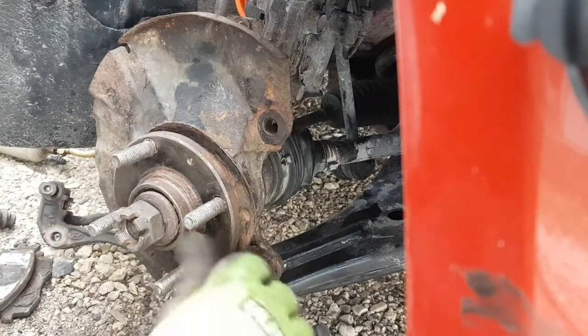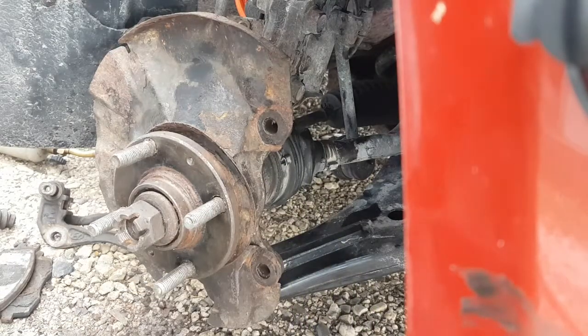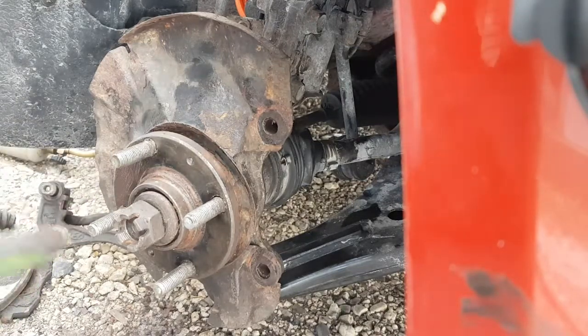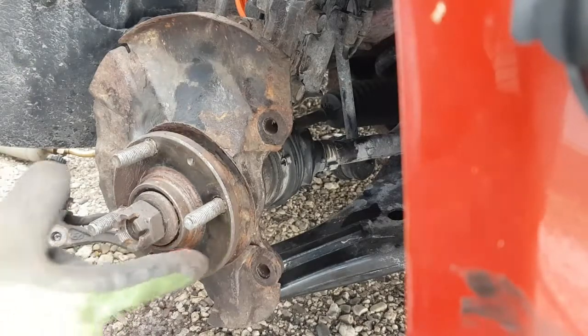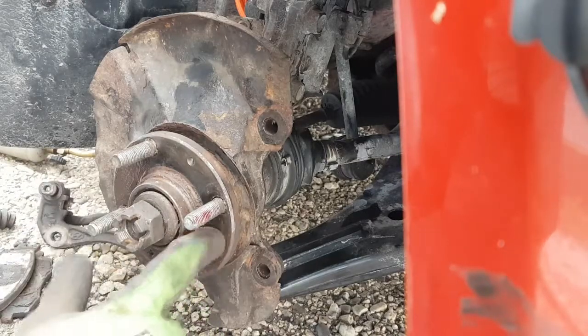There's still a lot of grease in the hub. I wonder if I have spray grease here. I don't think I do. So I'm gonna try and do this without getting my gloves too messed up with grease. I'm just gonna give it a light smear, a really light smear. I really don't like using actual grease in between here. I'd rather use a spray grease, like HHS 2000, the Wurth stuff, or motorcycle chain lube.